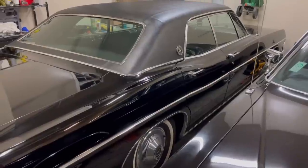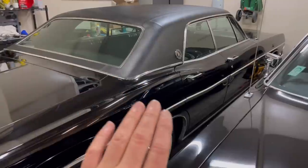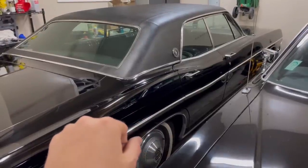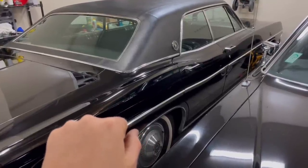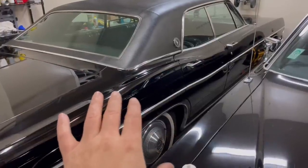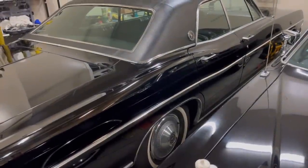My polisher is an old Milwaukee polisher that weighs about 15 pounds — it's pretty heavy. Whenever I'm doing these cars I don't really even push; I just let the weight of the polisher do the work. Then as you get toward the end and want to get rid of any potential hologramming, you turn the speed all the way down on the buffer. If I turn the speed all the way down with polish on the car, the wheel won't spin, but if I start pulling up and relieving the weight of the polisher it'll start spinning slowly. You want it to spin slowly with almost no weight on it. Do that for the compound and for the last pass in the machine polish too — slower speed, take the weight off the polisher. You'll still have some minor hologramming, but it'll be pretty minor.